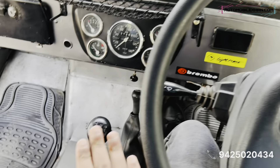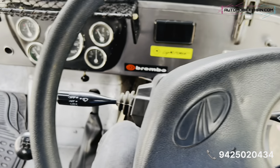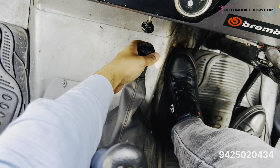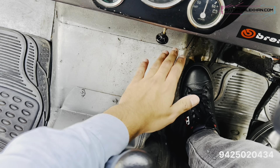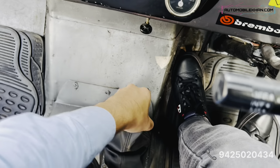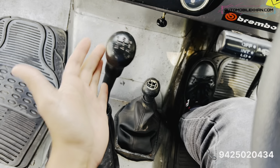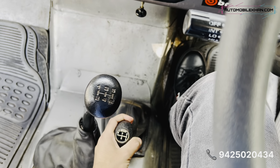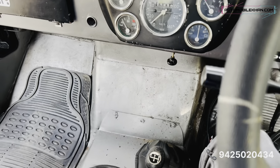Now I'll show you the 4-wheel setup and gearing pattern of the 5-speed 4-wheel drive. This lever is for simple gearing and this is the 4-wheel lever. So this is 2-High — 2-wheel high speed. Then 4-High — 4-wheel high speed. After that is Master Neutral. If the car is in first gear and you leave the car, this is the Master Neutral position. And this is 4-wheel Low — 4L.